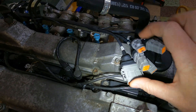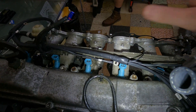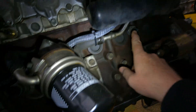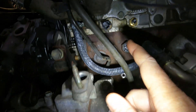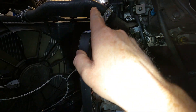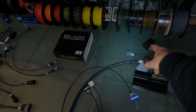That covers all of these over here. They obviously go through the inlet manifold and come underneath there, so you don't have this big chunk of plugs on top - it's underneath, well hidden where nobody can see it under the inlet manifold itself. Most of the stuff that's in there is obviously underneath here - you've got your knock sensors over there and over there, your oil pressure over there, your starter motor over there, a little starter plug which goes down through there, and your throttle sits over here. Your IAT just goes along here to meet with your intake pipe over there. In this case it's plug and play - even simpler. You just plug in all the body plugs, plug in your two ECU harnesses, and you go from there.